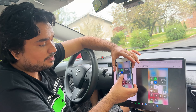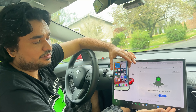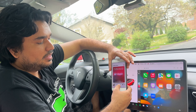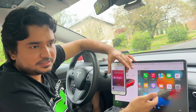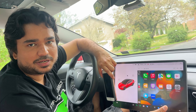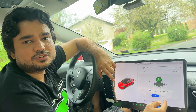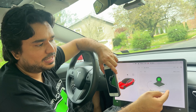So you have iPhone cast now, but you can't touch anything there. A lot of people ask how to go back to CarPlay because you can't just slide to it. What you have to do is go to your phone and stop mirroring. It will not automatically connect to CarPlay — the phone is waiting to be connected and you have to hit the link button. When you hit link, CarPlay starts working again. So if you're in cast and your phone is not connecting CarPlay, that's your issue. You need to be in link for CarPlay, cast for cast.